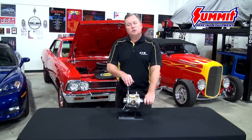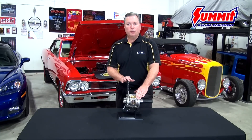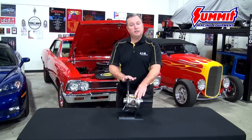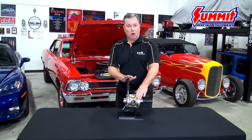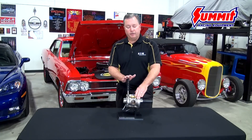What that means is that at that point I am delivering 100% of the driveline power equally to both wheels — that's the best you can do in terms of continuing to move your vehicle forward. The housing or carrier design is optimized for any given axle application using advanced engineering techniques and validation activities that take place at our Research and Development Center in Marshall, Michigan. All of the same testing done for our OEM customers around the world is applied to the E-Locker to ensure you get a product that performs as you expect for the life of the vehicle.